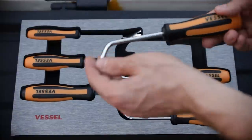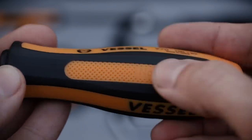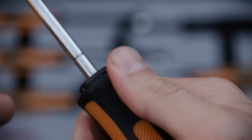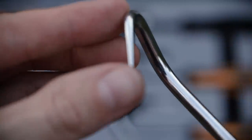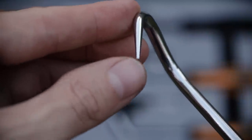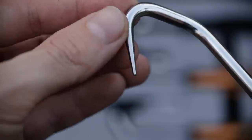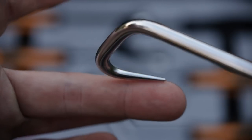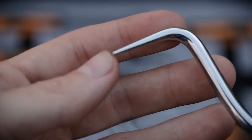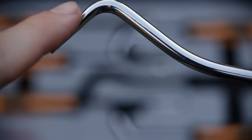Let's look at these radiator hose picks. They've got a nice non-slip grip with a little bit of texturing on the handle — a nice comfort grip that fits pretty well in the hand. Nice big pick with a nice blunted end — it's not sharp, not going to put a hole in your hose — but it does have a nice small point to help wedge it up under the edge of that hose and work around to break that seal. With the set you get two curved picks, one each direction, and one that's got kind of a swoop into a 90-degree angle.